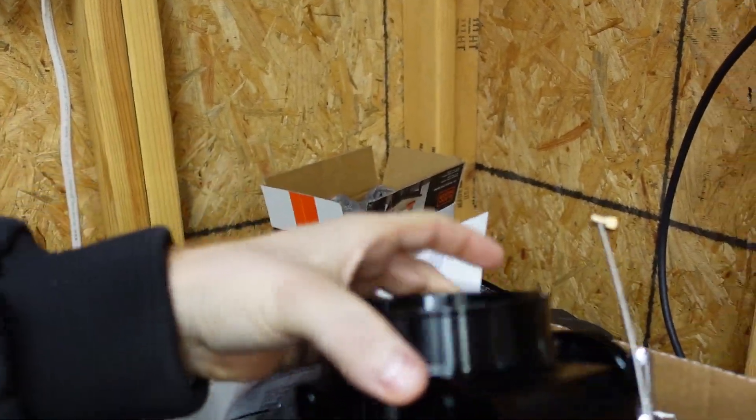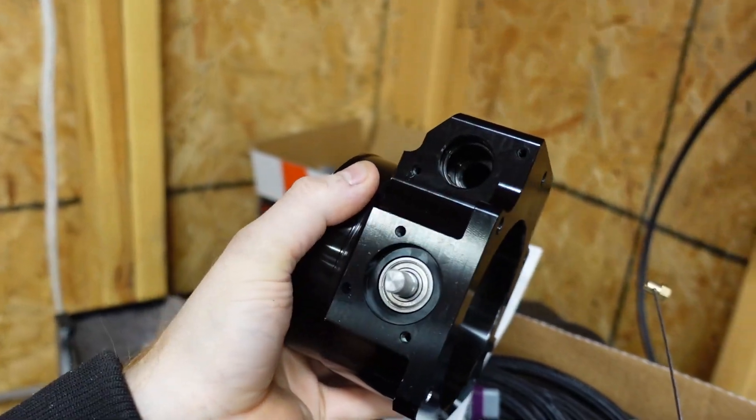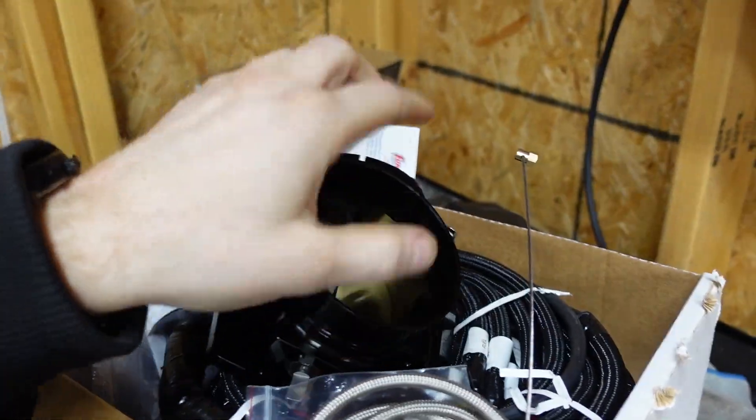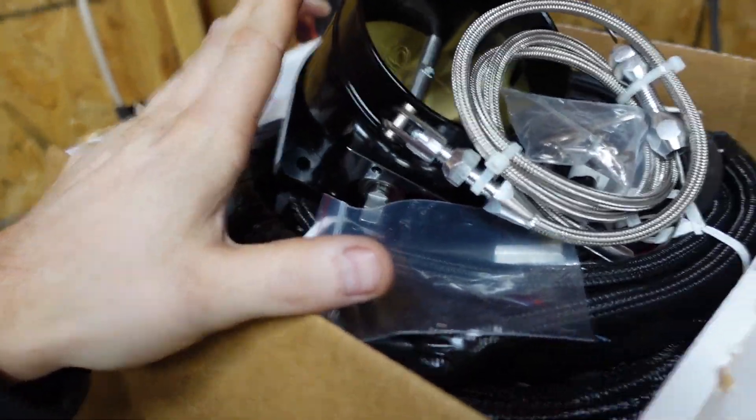I actually had to go to a drive-by cable, so I went ahead and got this Amazon special 92 millimeter throttle body. I hope it fits on the turbo intercooler piping. It came with my IAC and my TPS, so all I gotta do is hook that up with my drive-by cable. They do make this for drive-by-wire - that's called the Holley Terminator X Max - and that's for transmission controls as well. Today's video is going to be me installing this thing and finally making sure it's not going to blow up on me because of my tuning.